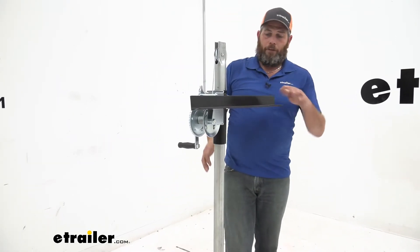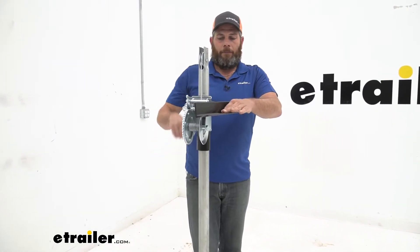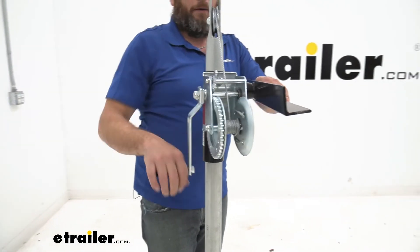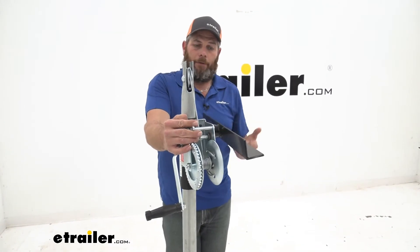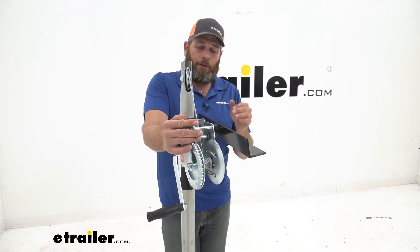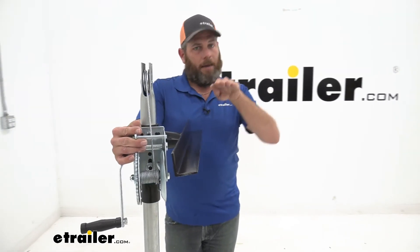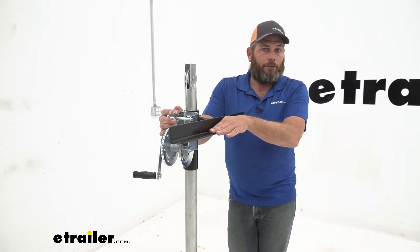You're going to bring them in, position them, and slide them right under the edge of the camper. Get that released. At that point, we just crank our handle to lift them up. It's important that you find the center point of your camper — if you've got them too far forward, it'll want to tilt back; too far back, it'll want to tilt forward. So you just lift it a little bit and make sure it's balanced on there properly.